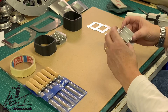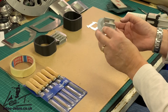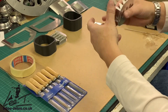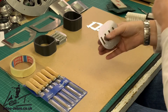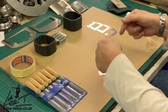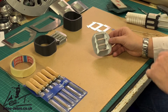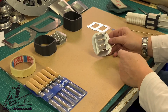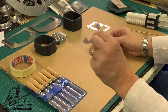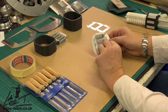So that's a nice fit. Once that's done, you can then install — because these keep it nice and square. Once these are all home and pushed flat to the back plate, you can then glue these tags in place, again with the same glue. So you glue them in and then you won't have this problem. So that's your top — they're slanted upwards to the back. Then once this is all glued, just be mindful of where these go because they can cover some of your glue points. You can glue along some of the outside edges here because this will cover it up.